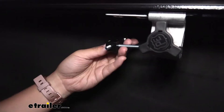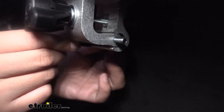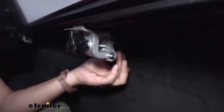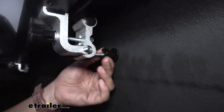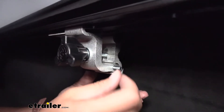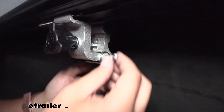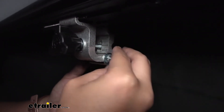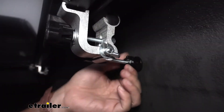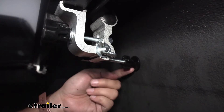Make sure your clamps look correct, then fit the kickstand through the clamp grip — there's a hole perfectly sized for it — and adjust the kickstand so it's flat against the truck bed. Then get the wing nut in place with a flat washer and split washer, tighten until the split washer flattens out, and continue tightening the kickstand down against the bed wall with good pressure.